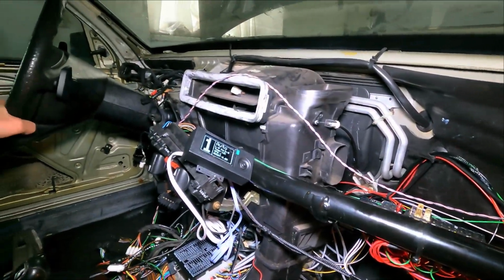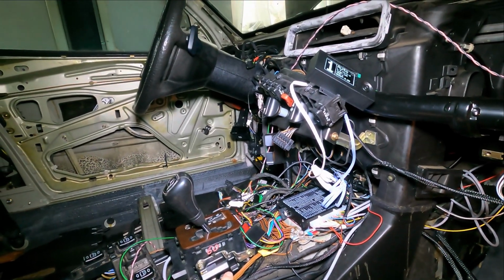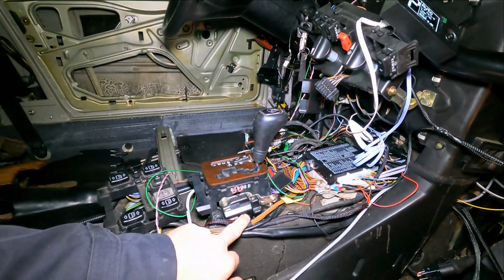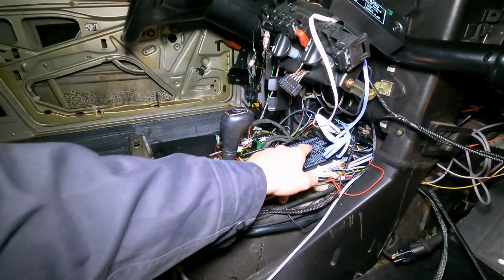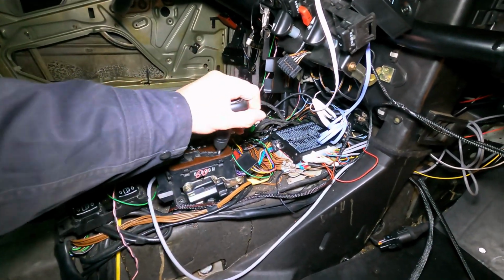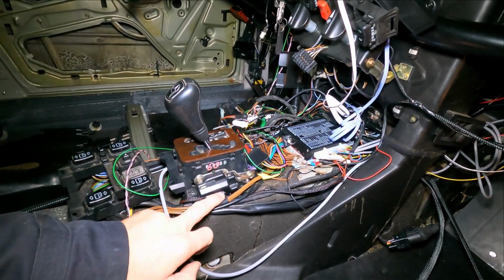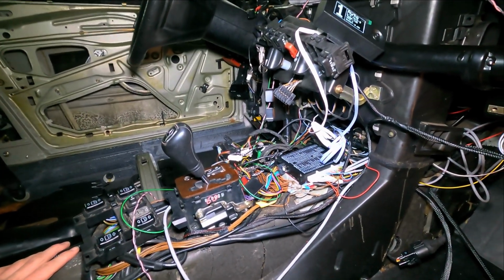So also transmission is all connected. I've done some things maybe different than some other people have done, but I have also connected one auxiliary output of the Ofgear that you can use if you're going above 10 kilometers an hour. It will switch this solenoid, and you cannot put it in R or in P. That's also what I used in the last one. That's an original setting. Not everybody uses it, but I'm using it.